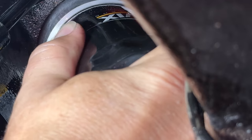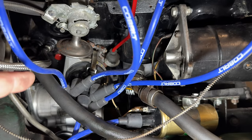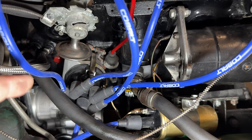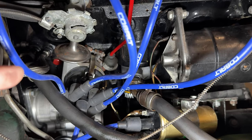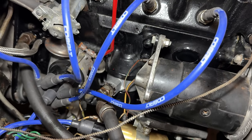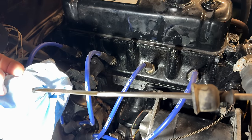Now just use a little bit of the oil that you will have all over yourself by now. Put it on the end of your oil filter and get that spun on. Never use any tools to install your oil filter — you just want these hand tight. Now at this point you can start your car up, check for oil leaks, and then shut it back down. The oil filter is going to fill with oil, so after you turn it off, check your oil again and add the appropriate amount. Everything looks okay. It's just below the minimum level, so I'm going to put one quart in.